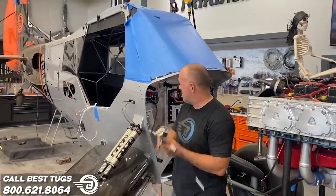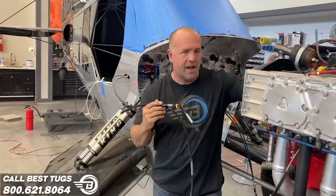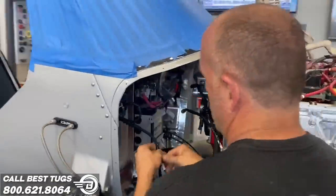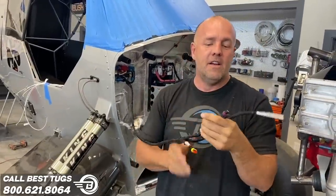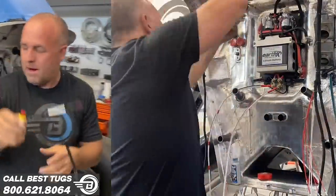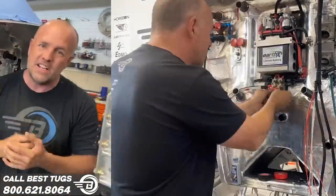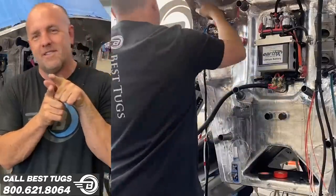I've got one harness done — really simple, just five sensors: three on this end, two at this end. I labeled them all and lined them up at the back of the engine so it'd be difficult to plug the wrong one into the wrong sensor, because they line up at length. Some of the plugs are the same since they use the same sensor, but when I can I use a jumper plug that's a different style so you can't plug it in wrong. One harness down, about four more to go. I like to separate pressure gauges and engine sensors on one, ignition and timing on another, fuel controls on another.